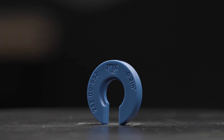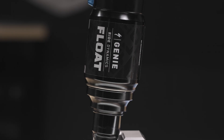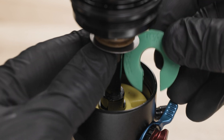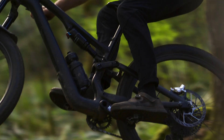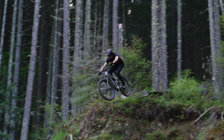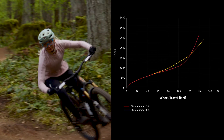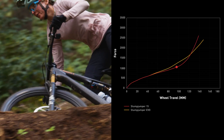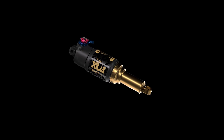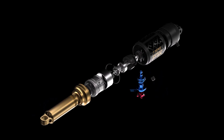The smaller blue and green eyelet spacers fit within the secondary air chamber. These affect the end-stroke and bottom-out resistance. The stock blue 0.2-inch spacer can be swapped out for the 0.4-inch green spacer, decreasing volume. This adds more bottom-out resistance, useful for riders using up all their travel on large bumps and hard landings. Riders who are not using all the travel should try removing the stock 0.2 spacer for less ramp-up on the end-stroke.